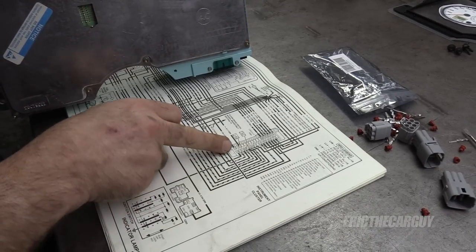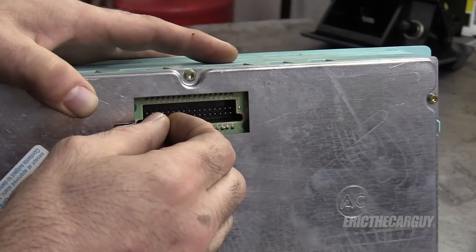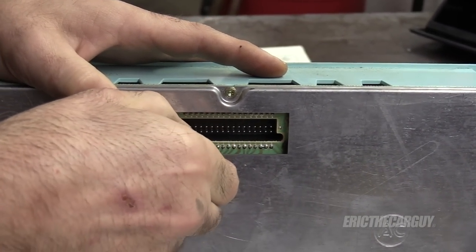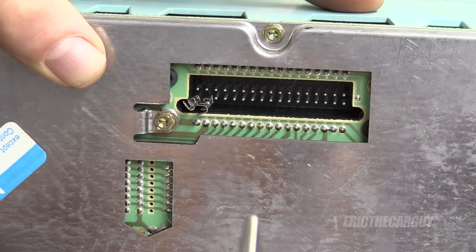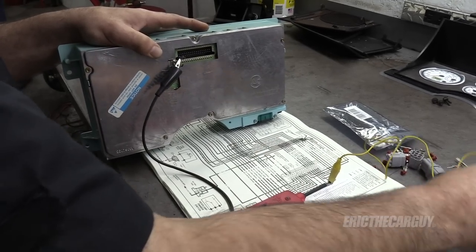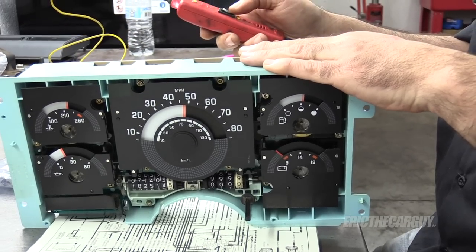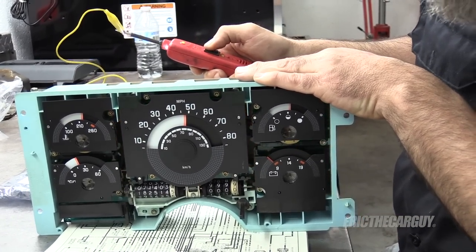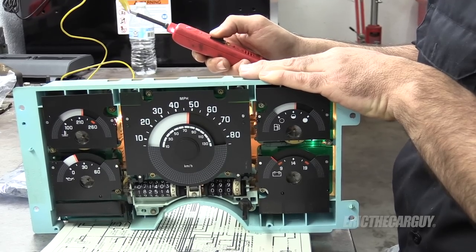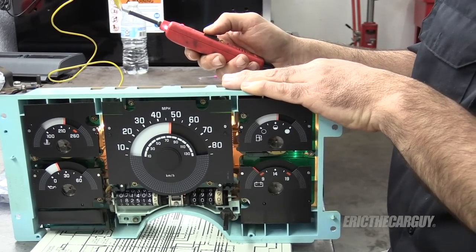Number eight is illumination and it's right next to 150. So if we very carefully sneak in here with our little connector — adjusting them so they're not touching one another because that will directly short it out — we can tie this to our ground and make this the power coming in off the power probe. So now when I activate the power probe, I get illumination. We know that circuit lights everything up, and it's connected to the dimmer switch, but that kind of doesn't matter because the new gauges have their own dimmer switch. When we turn the headlights on, the new gauges will light up just like these are.